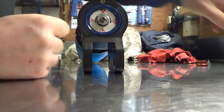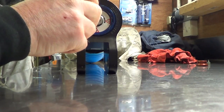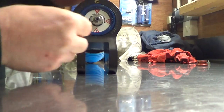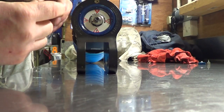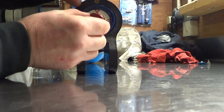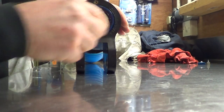When you've done that up, make sure your white Tip-X is still lining up at zero — that it hasn't turned while you've been tightening. Sometimes you may have to loosen it and bring it back a little bit past zero, so when you tighten it up it comes up to zero. Again, your 1.5mm allen key — tighten up your grub screw to a nice little nip. Now you're ready for your rebound adjuster, your red one. Get your scribe mark coming up to zero — it lines up with your Tip-X also. Your 13mm socket again on the end, tap it home. That's that in.